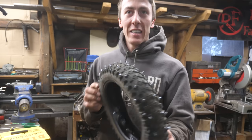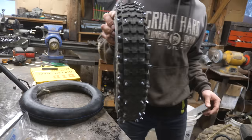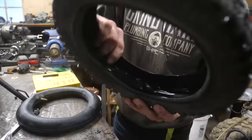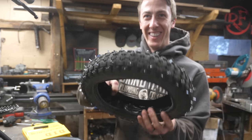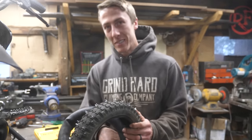After driving 90 self-tappers through here, we got it studded. And to protect the tube, we used Gorilla Tape — a lot of it — and hopefully that will do it. Looks professional. That's how you do it after you stud your dirt bike tire — you do little strips like that in there. So let's put the tube in, put it on and see if we can get some traction.